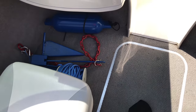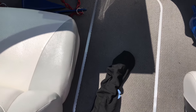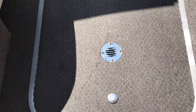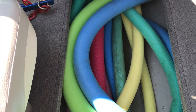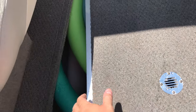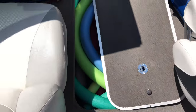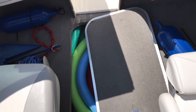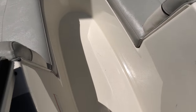I keep the anchor out as well, just so it can hopefully not dry rot. Something else I do is open the storage underneath and keep it propped open during dry storage, so it can get air. If there is a little bit of moisture in there, that should better prevent dry rot. Obviously the front of the boat — I went in and did a thorough cleaning job there too.